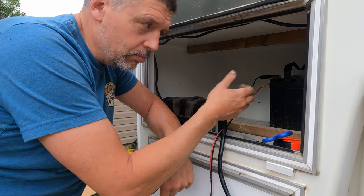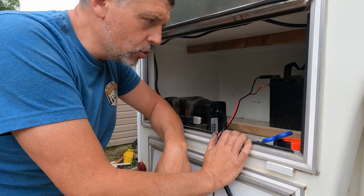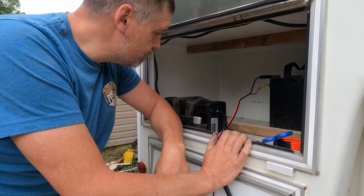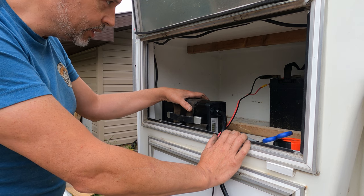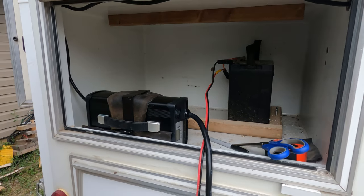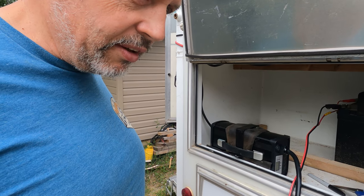It'll just be two screws if I ever need to get it out of the way. To take the inverter board out there are a couple screws for the charger, a couple wires to disconnect, and four screws on the board itself. I only need to do that if I need to get the batteries out — like if I was winterizing for storage or had a battery issue down the road. Really not something I should have to access much. Next I need to get the batteries in place so I can get the inverter board mounted.